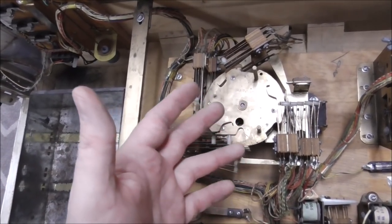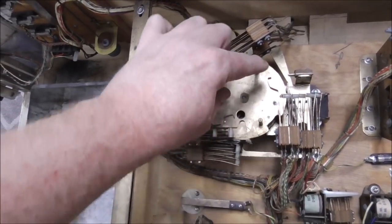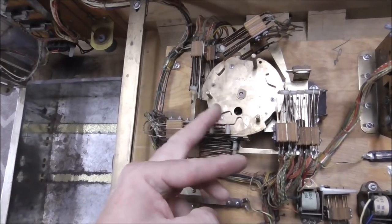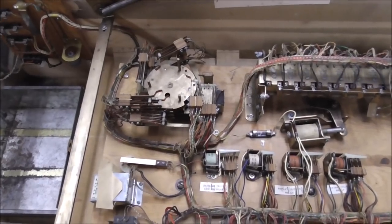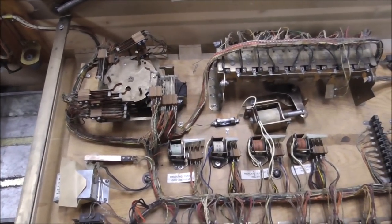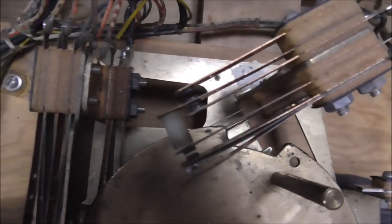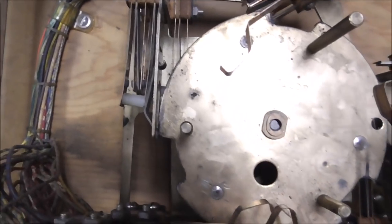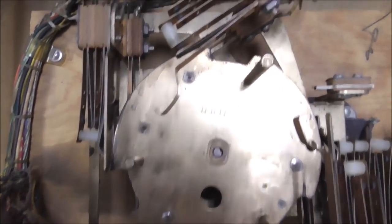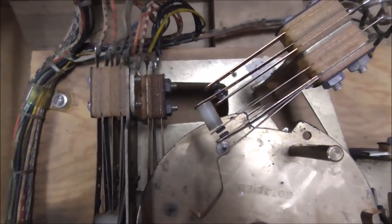And so if it needs to score 30 points or 50 points, there's a switch on one of the little cogs down here. And as this turns around, it presses the switch five times, which makes the point score five times, which gives you 50 instead of 10, and all of that. So you get kind of an animation and then kind of a math effect out of that. But it's very straightforward. You just basically, same thing, clean the switches, and then if they're closed, they should open. If they're open, they should close at some point. If you get them and the switch is always closed and it never opens, something's wrong. It's not adjusted right, so check that out and figure it out.